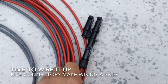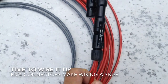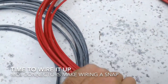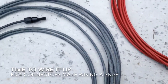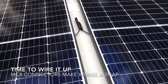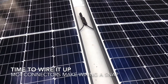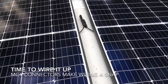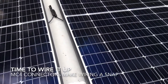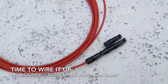I'm on to wiring, and I believe these connectors are called MC4 connectors. I prepped stuff prior to getting up onto the roof of the trailer. You can see I have a positive lead and a negative lead. Between the panels those are my two negative connections. I am wiring my panels in parallel, so both negatives will get joined to that MC4 Y-connector, and then both positives will get connected to this MC4 Y-connector.